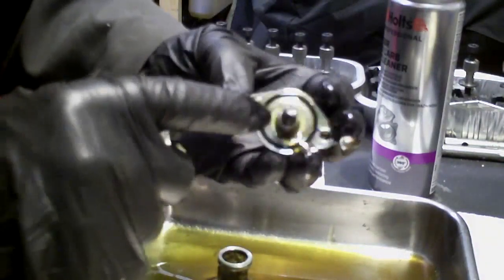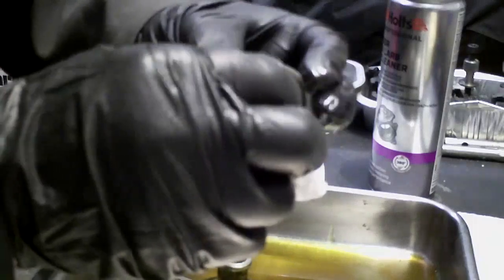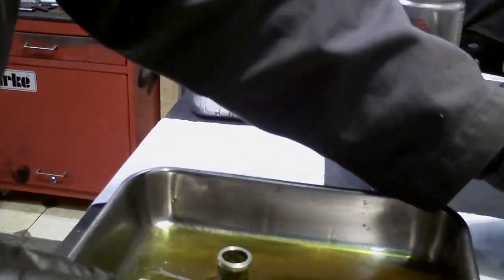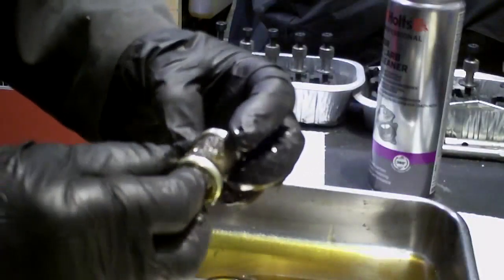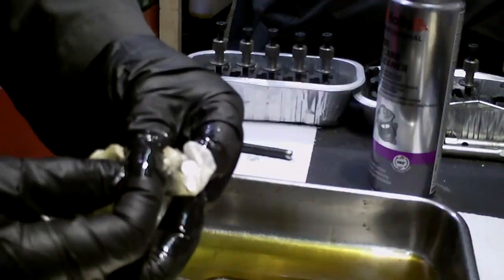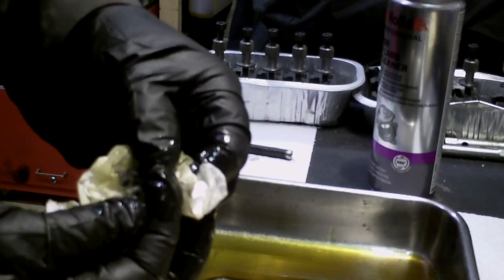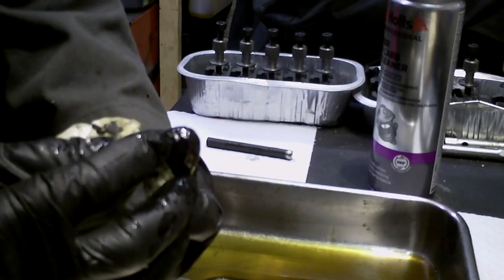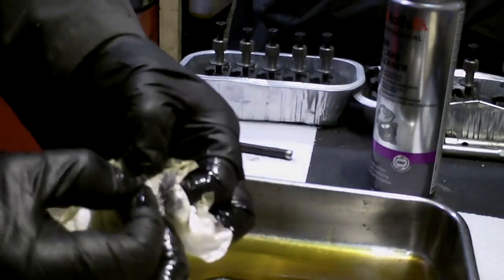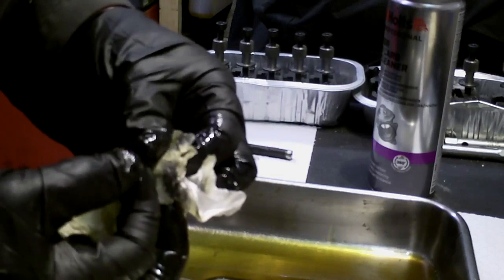There's the gauze sump plate. There is some fine dusty material on the magnetic plug, but there are no sharp particles or shards. And the gauze filter itself, there is some debris on the filter, a sort of almost like silicone gasket material. So that's flange gasket material from the engine assembly, I guess. Superficially it looks like aluminium, but it's not. It's all rubbery.